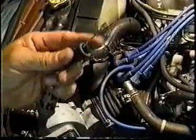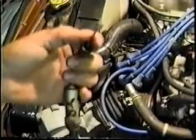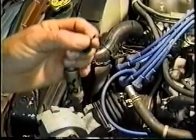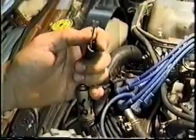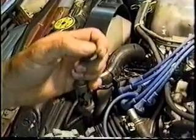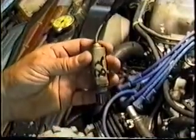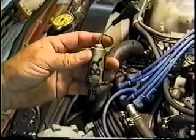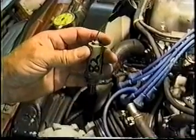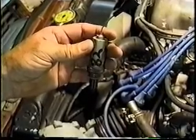This is all nice smooth silicone. All of the connectors on all the Z cars have a female spade connector on the electrical connection. Don't be afraid if you've got more than one wire on here — one of them is just to warm it, one of them is to take the signal into the system. This is actually a generator — a small electric generator that produces a very small amount of voltage.